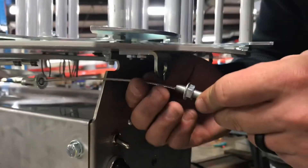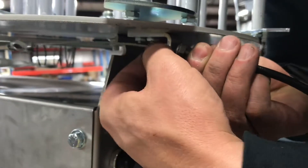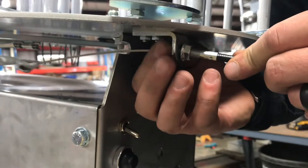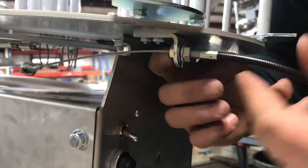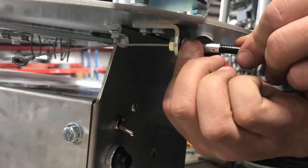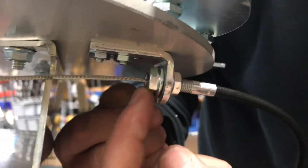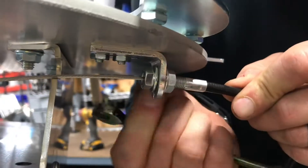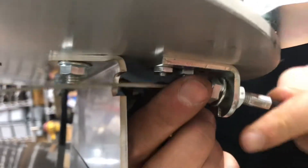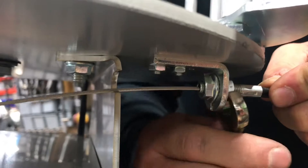Now take the other end of the cable and put the wire through the retaining nut and start threading it on. On this side, the approximate location is that the cable should be just going through the nut — the threaded portion should just barely be showing through the nut. Adjust as needed, then snug this part down once you have just a little bit of thread showing.